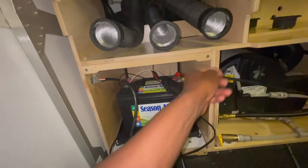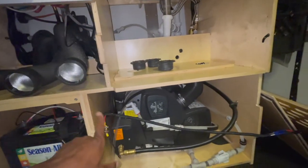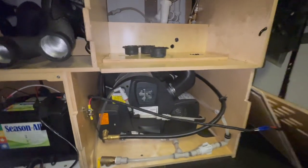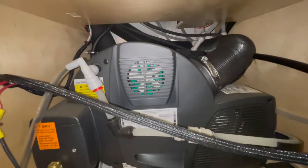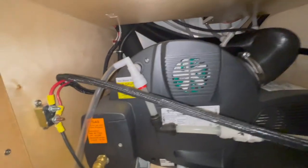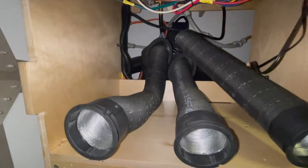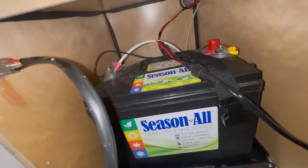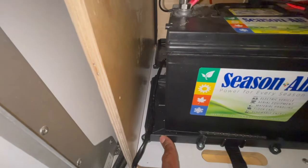As far as the battery panel down here, it's just a bunch of thumb screws — you just unscrew those. Same thing with this upper section — it's four Phillips screws and you just unscrew those, and that's how you get in there. This is your Truma system — water heater and furnace heater all wrapped into one. This is where your vents come out of. The current battery is very simple — it's got to be like a Group 24 or something like that, but you can put a maximum of a Group 27 battery in here.